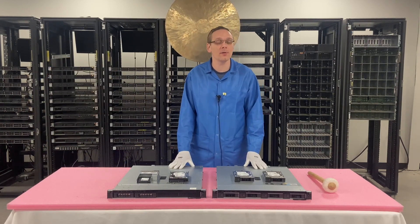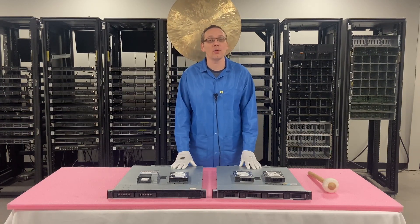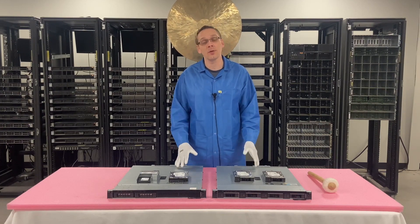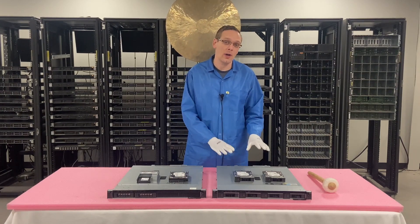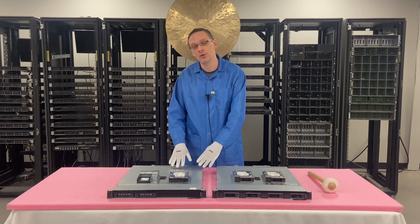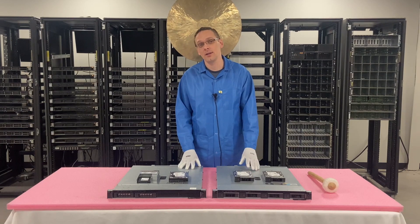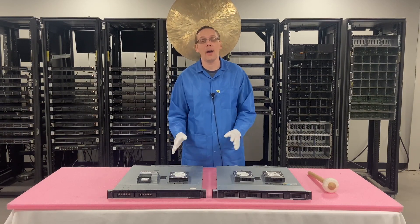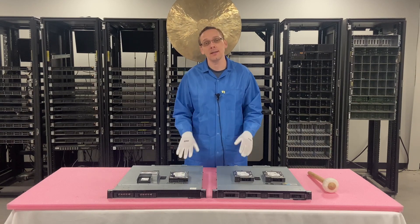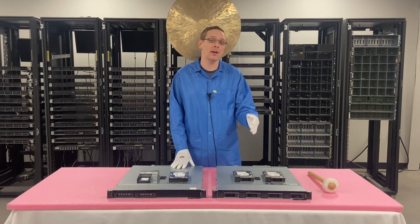This video is going to be specifically focused on drives, so we're going to cover all the different types of drives that are compatible with the R240. We're going to go over the speeds, the max sizes of the drives, how to actually install them both in the hot swap and in the cabled server. Then we're going to show you how to actually test them with Dell Diagnostics and a tool we like called HD Sentinel, which allows you to test the power on hours and the health scores — a nice secondary test outside of Dell, especially if you're buying used drives.